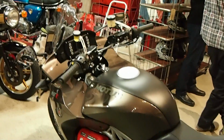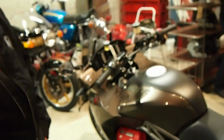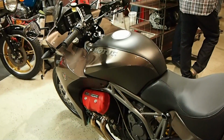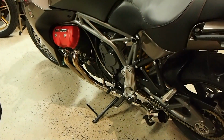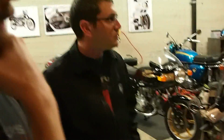Now, you guys were throwing out some very impressive figures during your presentation. What are some of those numbers in terms of power and torque and weight and all that stuff? Well, the MST has about 160 horsepower at the crank, 125 foot-pounds of torque, and the MST-R goes to 180 horsepower and 120 foot-pounds of torque, so a little higher peak output there. Very good power-to-weight ratio on this bike. The whole bike weighs 550 pounds wet. Extremely powerful through a broad range. You basically have about 100 foot-pounds of torque, around 2500 RPM.